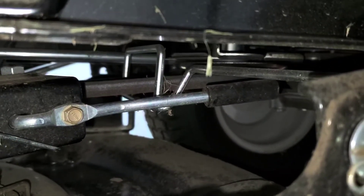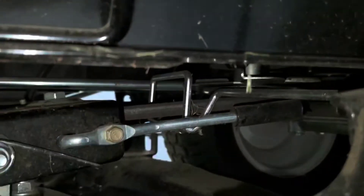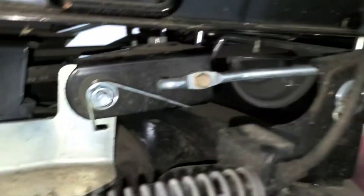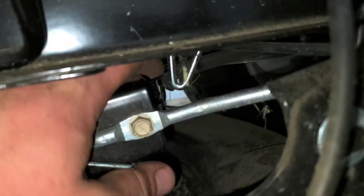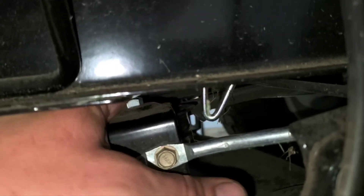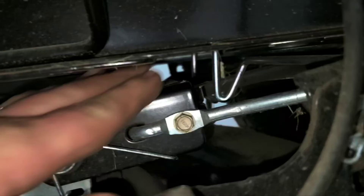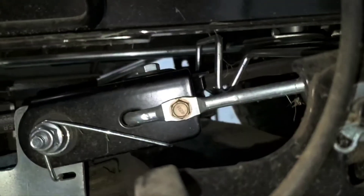I checked that out originally, just wanted to go over it with you. This idler pulley — when the deck is disengaged, there's a pulley right here that should move freely. If it doesn't, your idler pulley could be locked up, but you'd smell that with a burnt belt anyway. Just one other thing to look at while you're down here.